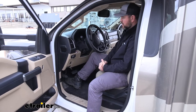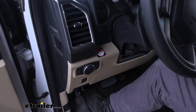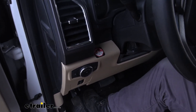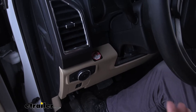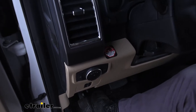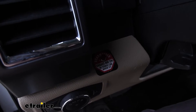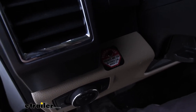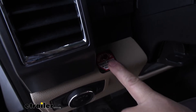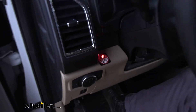Adding this light in your motorhome is going to let you know that your brakes are being applied in your towed vehicle, whether that vehicle or braking system already has a light on it. In our case, our customer's braking system in their towed vehicle has a light mounted inside the towed vehicle, but the problem is where the light is mounted — when the sun shines down on it, it's hard to see in the camera on the RV. So they wanted to add a second one so they know when this comes on that their brakes are working in their towed vehicle.